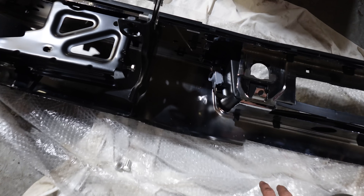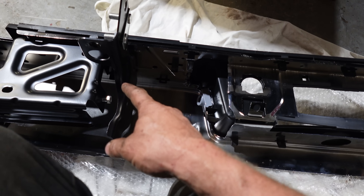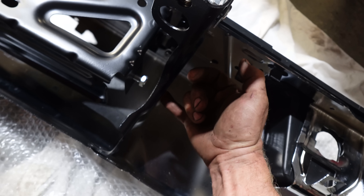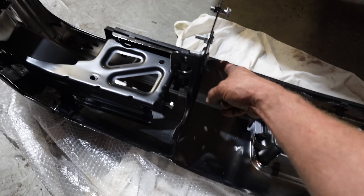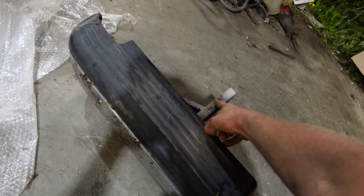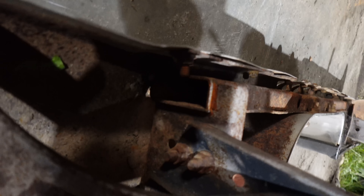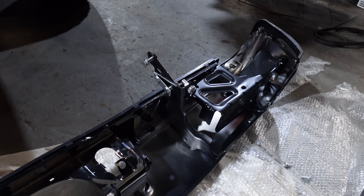So the back bumper - the frame is way wider on a new GM, but if you take the left bracket and put it on the right side and the right bracket on the left side, I'm going to have to get a spacer there to line up these holes because that's your step. If I cut this off and then weld this bracket at the right height and the right depth, in the right spot, it'll bolt right in and slide right in there like it was meant to be there. I'm just gonna soak the bolts in some penetrating fluid tonight and tackle this in the morning.